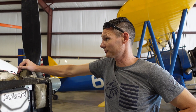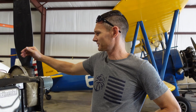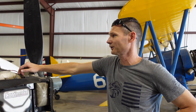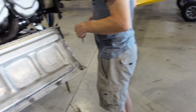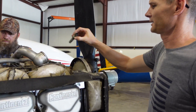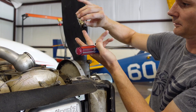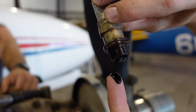The T6 has been out of annual for 12 years but should be good because it was turned over inside and people kept an eye on it. This 310, though — literally had a blanket put over it for 38 years before I got it. That's not good. This cylinder is wet but not full. You can get a little dramatic with it — there it goes. That is something you do not want to see, especially considering we only ran it for 20 minutes.